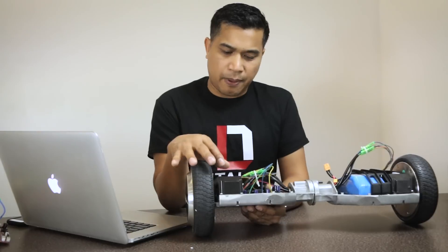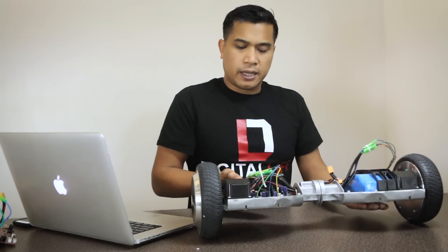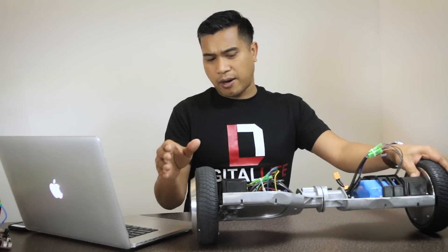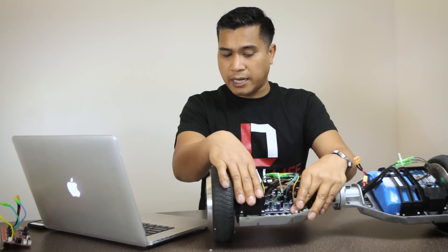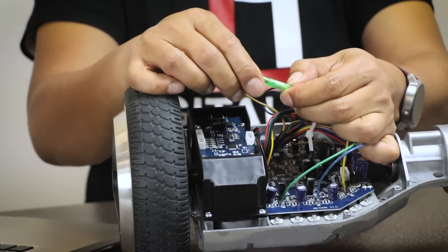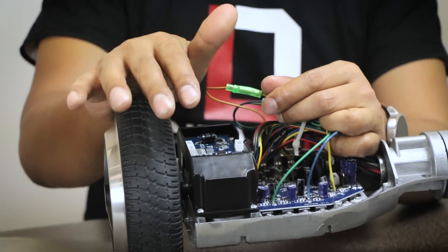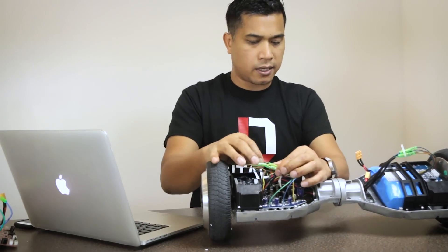Your problem looks like the balance sensor is not reading properly. Each sensor needs to be online — once you step on the board it needs to read pressure from both sides for the accelerometer to calibrate. You may have a calibration issue where the wheel is not resetting properly. That red light could indicate various issues: replacing the balance sensor may not fix it; replacing the logic board might. It could also be a bad motor or a connector issue. Check the yellow, green, and blue wires to make sure they're fastened, as there may be an issue sending power to the accelerometer near the wheel. Open the board and verify — check all connectors first.